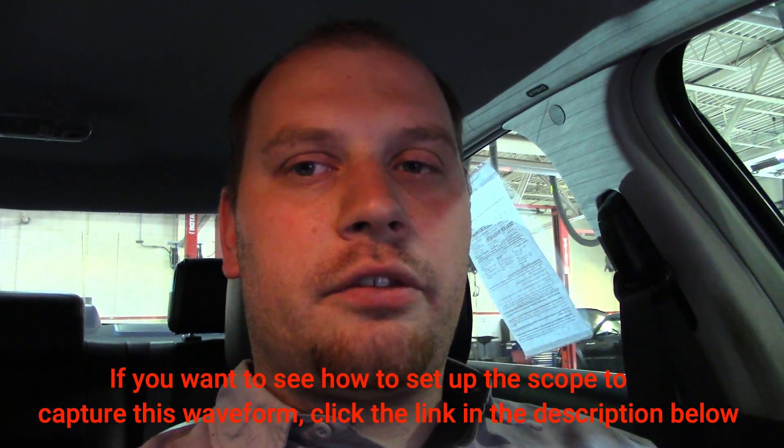So we got this from the auction for our used car lot. Knowing it has six brand new coils and six brand new plugs, and with how intermittent this is, I have a feeling I have a bad injector. It's about 93-94 degrees outside, so I'm going to sit here in the AC and wait for this car to misfire. I already hooked up an amp clamp to the fuel injector fuse and ran a lead from the power side and the ground side of the injector, so when it acts up we should be able to see if it is a fuel injector or not.